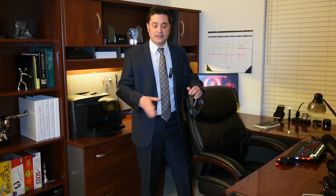In addition, we got the memory overclocked from a 2133 base clock to 3200, very easy with the G.Skill, and it was pretty much just an XMP setting to get that accomplished. And then when it comes down to the SLI, we got that set up with the Titan GPUs with the slight overclock. They will run a little hot if you're running very serious graphics or playing games for a while, but they stay within range and they are not throttling down within the case. We just set up the fans and curved them.